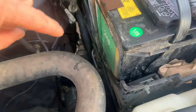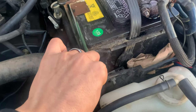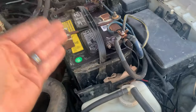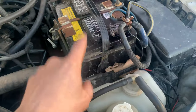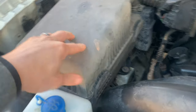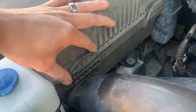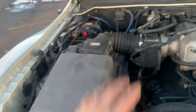On the less deadly side of things, I've seen so many of these with cracked battery trays — mine is cracked right here. They're made of some kind of weird brittle plastic composite, and people tightening down a new battery end up snapping off the tabs so they can't even strap the battery down. The air box is made of the same brittle material, and the tabs where the top of the air box and the MAF sensor slot in commonly break off. People then have to figure out another way to keep it secure so junk doesn't get into the intake system.